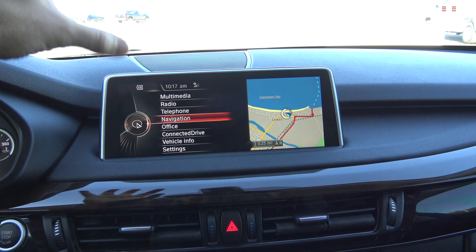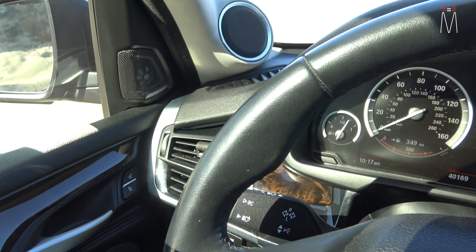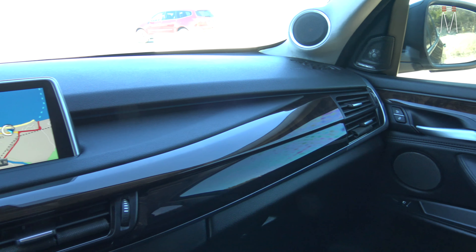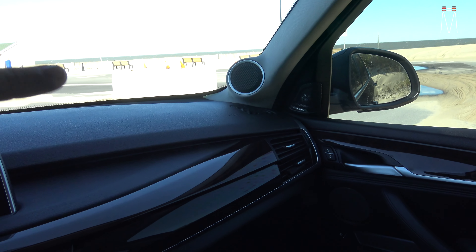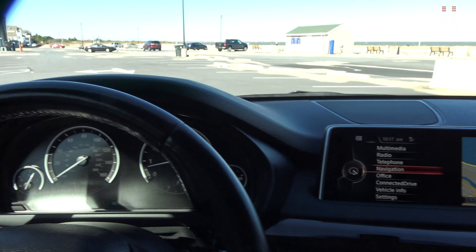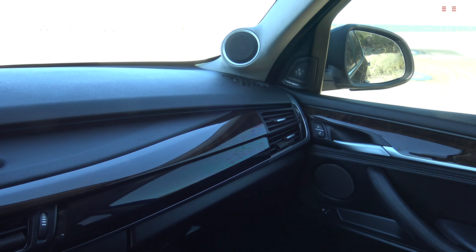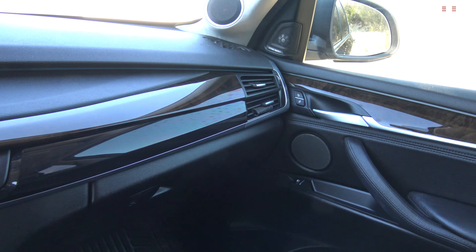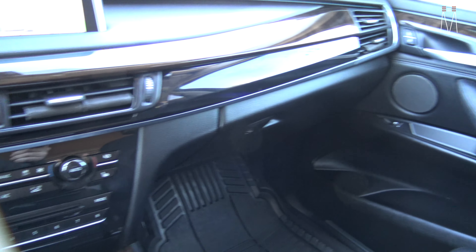There is no center channel that's been removed, and it sounds like there's a massive six or eight inch speaker right there on the dashboard. That's what makes it so beautiful when you can do this to your audio system — it's a complete game changer. Most people have never heard a car that is properly done like that. That's the whole reasoning behind why we do speakers in the pillar and try to avoid factory locations. BMW is always a little bit of a challenge because of all the obstacles they present with the locations of these drivers.